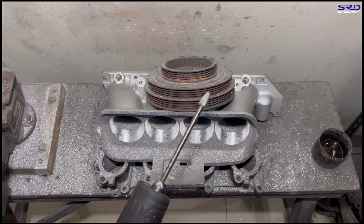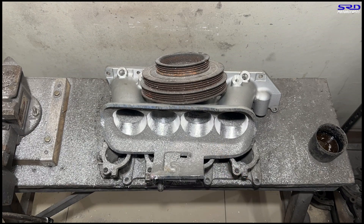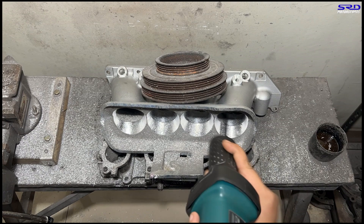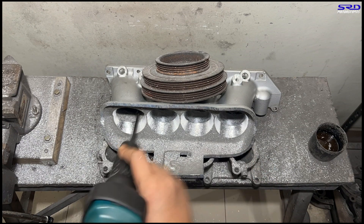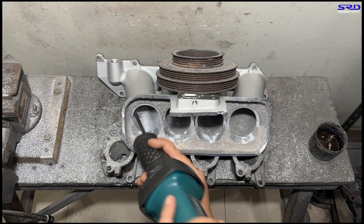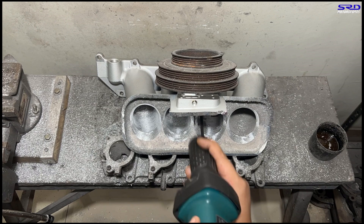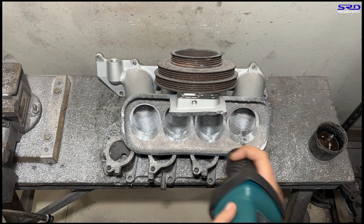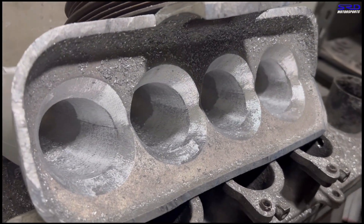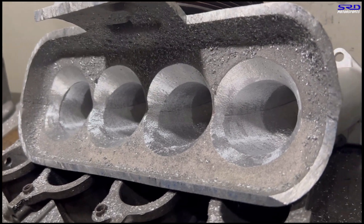We're using a generic carbide for now — we'll be getting some good ones from Head Games. We time-lapsed the whole thing and continue until about halfway through. We're going to enlarge it little by little so we have consistency on the taper on all four runners. Now we invert it for the other side. Watching this after working on it is actually quite fun because you can quickly see the changes. The taper is actually improving to an even more gradual, increased taper — this is going to give a lot of good airspeed.